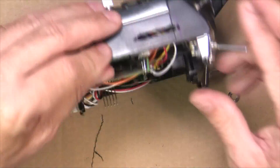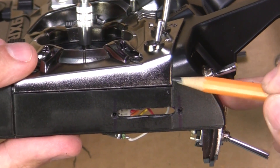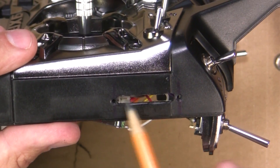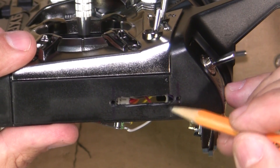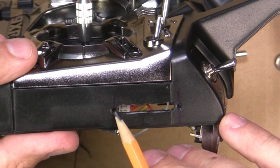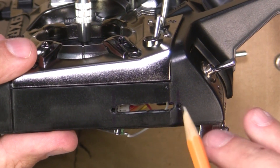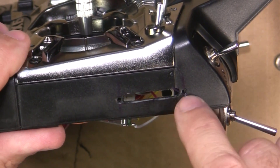Now we have to create a slot to put the new pot in. You'll see a line on the radio that's a good reference for where to start your slot. The slot only needs to be 25 millimeters long and about three to four millimeters wide. From the edge of the radio, the slot should start at around 9mm and finish at around 12mm. The mounting holes for the pot are 31.5 millimeters apart — just use a ruler to measure that. I used a Dremel tool, lined it up with a razor blade, made the marks, and drilled it all out.